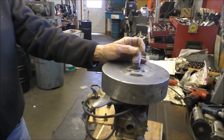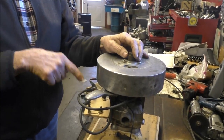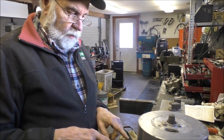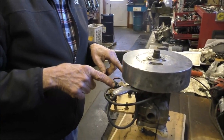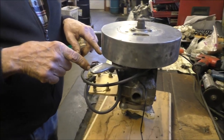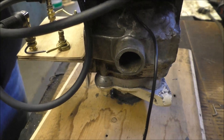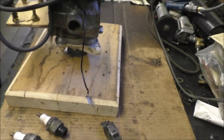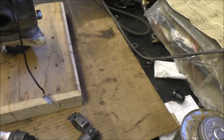We're going to try magnetizing it using the same two spark plugs. This is actually putting the thing really to a test. If I can hardly jump a spark here, that's the kind of gap we have to have in order to get spark — much more than that. On these spark plugs, we've got two spark plugs with a huge gap. Let's jump in those.